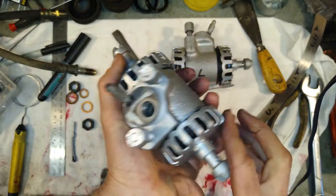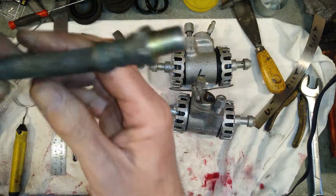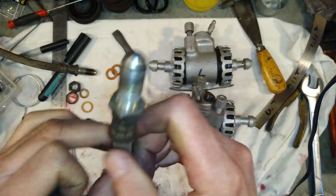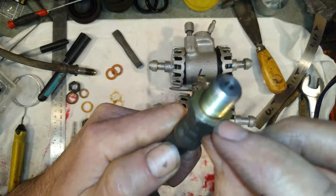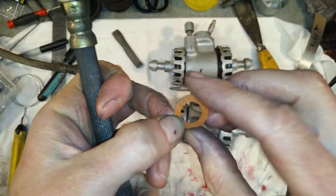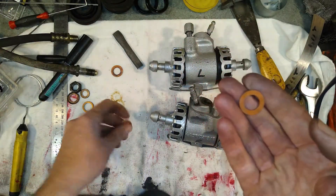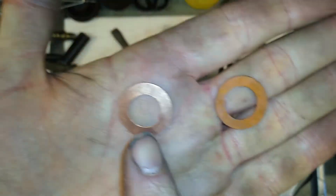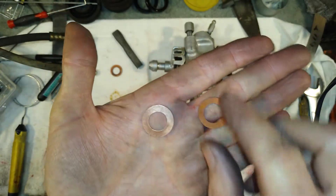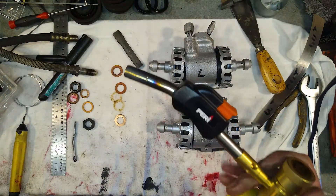Just one thing before we go and install them — which we do in the next video. This surface here, make sure it's nice and clean, because this is where your brake hose screws into the wheel cylinder. The other end goes onto the bundy tube with a flare fitting. To gain a seal between the hose fitting and this surface, we use a copper washer like this — I suggest you buy new ones. You want to anneal them to make them even softer. The difference between these two washers: this one is not annealed, this one has been — it's gone an orange colour, so it's much softer. The annealing process makes things softer, and if it's soft it crushes up nicely in there and you won't get any leaks.